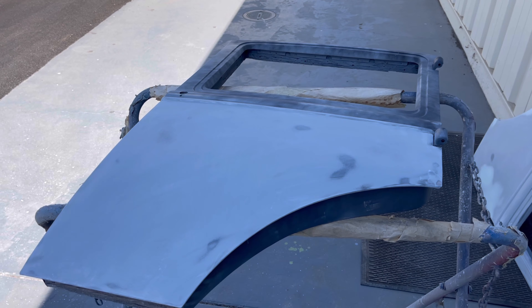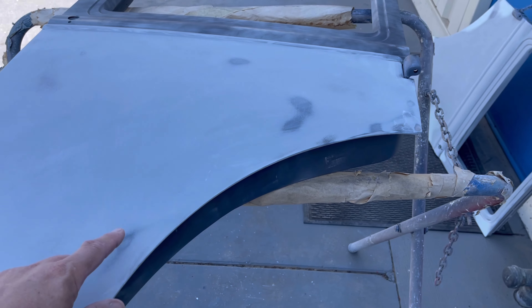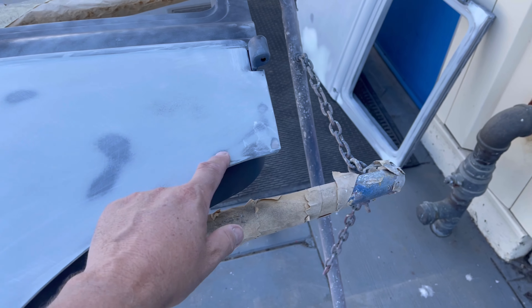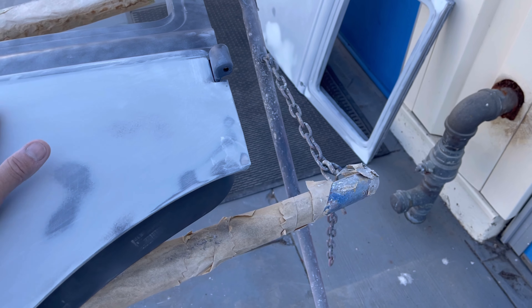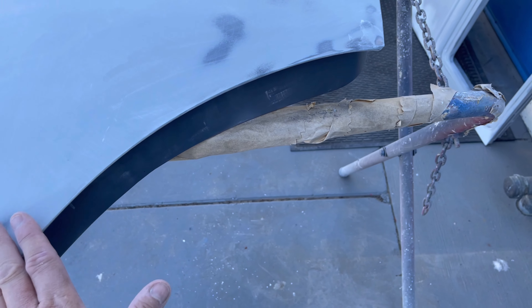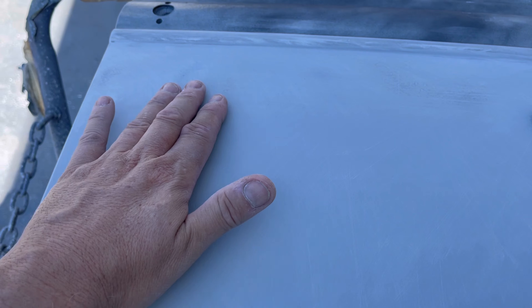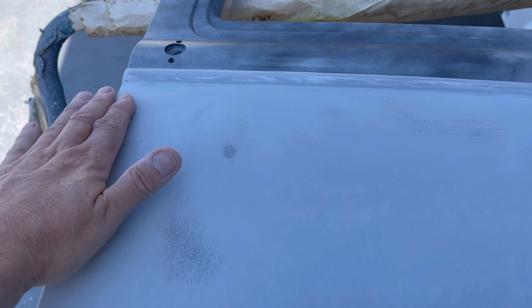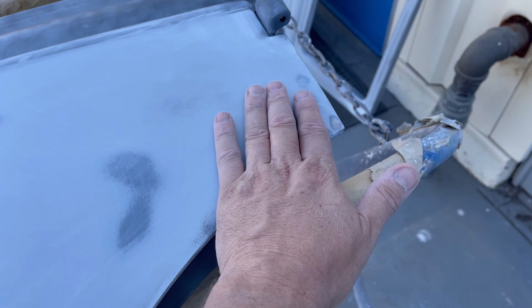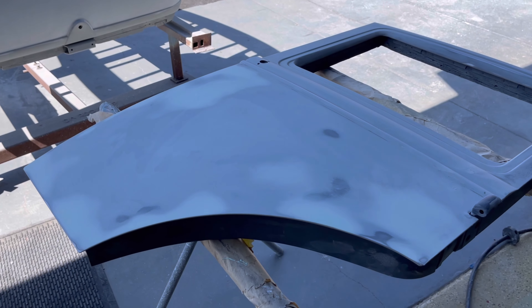Overall I'm very happy with this panel — about 20 minutes of blocking with a long block at 150. You can see where I broke through here, here, here, here. Up here it feels really smooth, but I did mention that high I felt, so I'm just gonna pop some glazing putty right along here, just feather it in. Actually all along this edge here is a low spot I tried to get. Got another low spot up here that I'll put a little glaze in. Pretty much I'm gonna glaze around the sides and block it again, but overall I'm very happy.